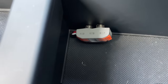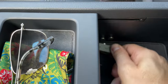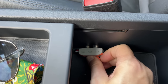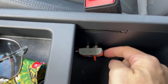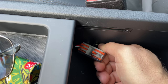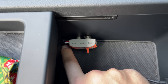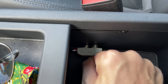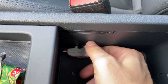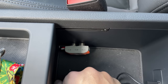To make it easier for me to temporarily hardwire in dash cams for testing, there's this new module that's installed right here in my center console. We attached it here with magnets so I can remove it as needed, and then it just clips right into place. It has these little connectors that pop up, and there are three of them — one for ground, one for the battery connection, and the other one is your ignition-triggered source. The cables actually run in here from one of the battery packs in the rear of the car. And then I can just open these guys up, plug in three different cables, pinch them back down, and bam — I now have my hardwire installed for different dash cams that I want to install on the windshield for testing. So that is definitely going to be super convenient.